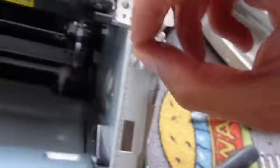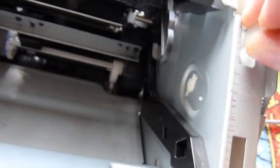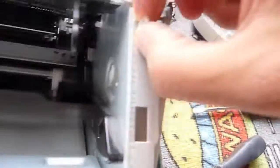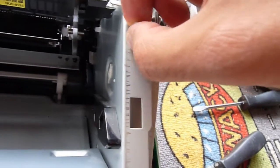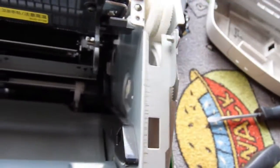You'll also find this plastic rod here, and you'll notice there's a little mechanism coming out there. That is the drive mechanism for the toner cartridge. And this, of course, engages a gear which will allow the toner cartridge to be easily removed when the lid is open, and engaged when the lid is closed.